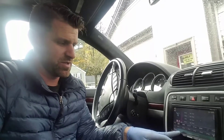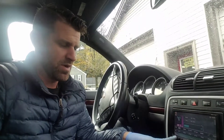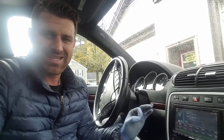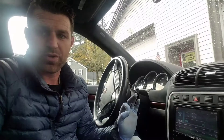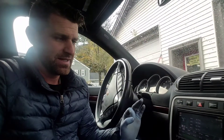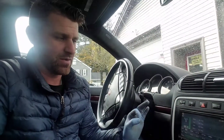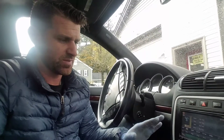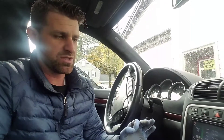Hey, what's up everybody. You'll notice me sitting here listening to my radio — well, a few minutes ago I wasn't, because my Kenwood stereo said 'DC offset error protect.' What does that mean? It typically means there's a fault in the radio and it goes into protection mode. Someone mentioned pushing some buttons and playing around, but no button worked or fixed it. Googling it said there might be a loose connection somewhere in the radio — could be anywhere from the stereo to the amplifier to all the speakers in the vehicle.